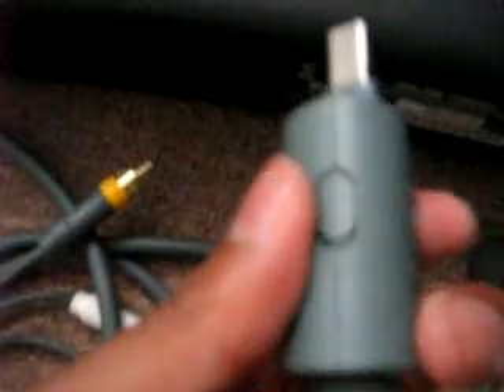This cable is used for getting high definition. It's a split-end cable with composite inputs on one end and component inputs on the other. If you're going to use the component side, you need to use the audio connectors from the composite side. On the side of the connector there's a switch labeled TV and HDTV. The TV side is used for composite or component if your TV does not support HDTV; flip the switch to HDTV and you get 720p or 1080p.